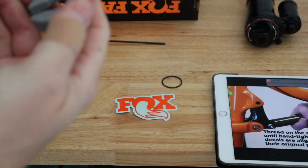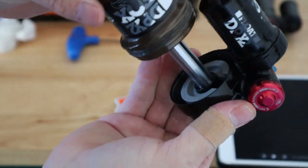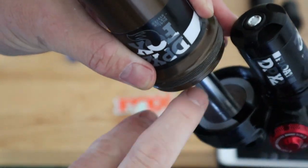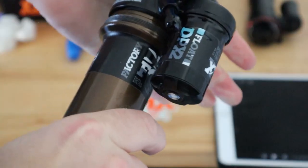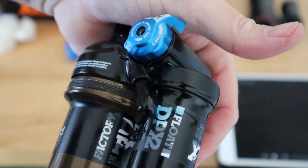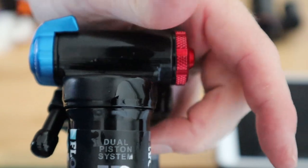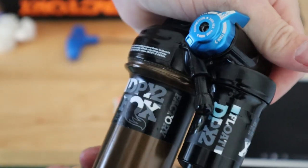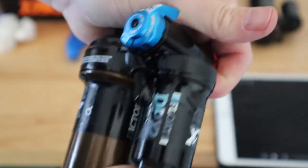And we'll get our gray spacer. Just snap that in with the counterbore facing the seal in here. Put the spacer back down and put our rubber O-ring back down. Now we'll close her up. I usually like to use my other hand to kind of, once you push the canister up, hold it up under the edge there on this particular shock, and that keeps force up into the thread, and that makes it much easier to actually thread the canister on, because there is some resistance.